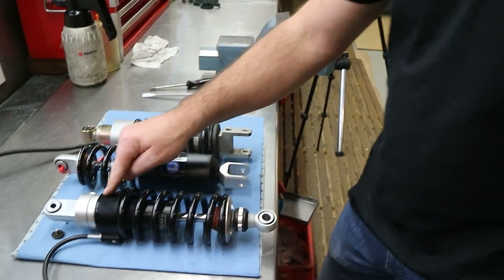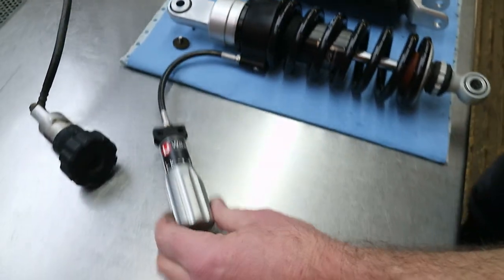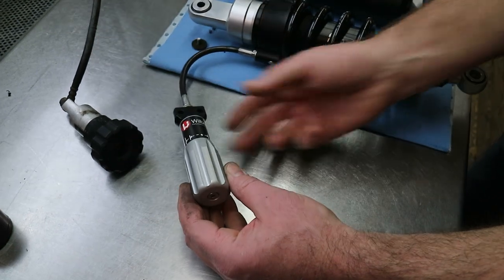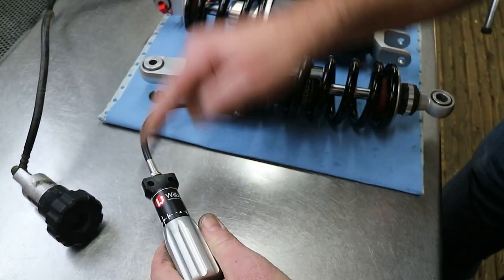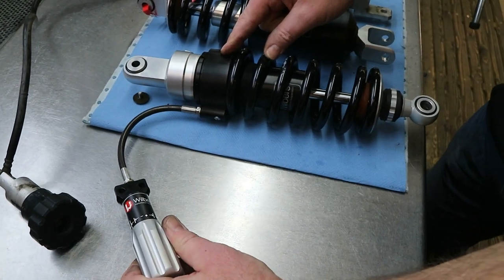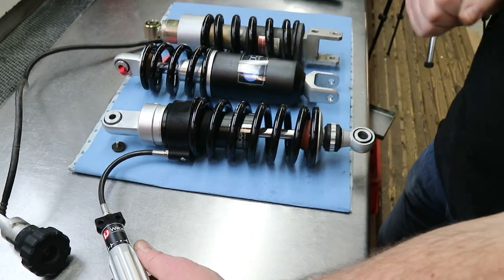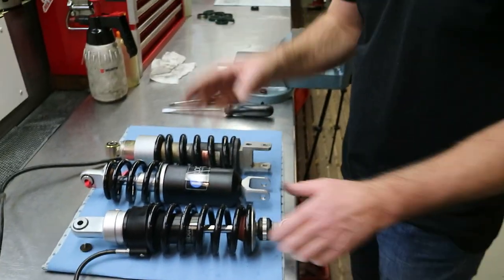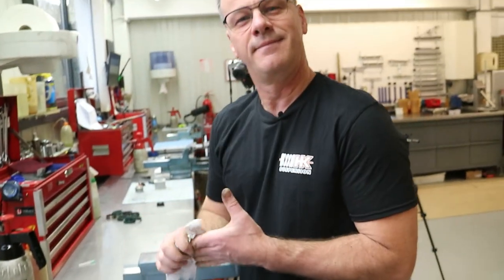And you also see the hydraulic preload adjuster, with the same knob as I have here. If I turn this one in or out, I press the oil inside this cylinder and push the spring in or out. But to be honest, I have had several bikes, and in practice I don't really adjust it a lot.